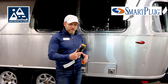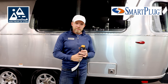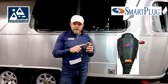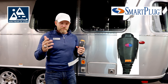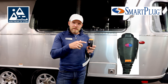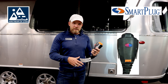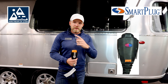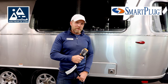Hooking it up is a cinch. First of all, you plug the male end into the power box at the campground, or to your generator, or wherever you might need to. On here is an LED light that's going to show blue, or red, or blue and red, or nothing at all. If there's nothing at all, there's no power to the cord. If it's just a blue light like it is now, that means power is okay — everything's good to hook in. If you see a blue and red, or a white and red, you know that there's typically a grounding issue, a cross-wired issue, or something on the other end of the wire, so you would need to disconnect and not plug it into your trailer.